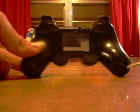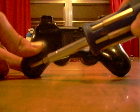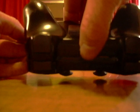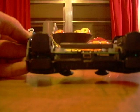If you remove the screw here, here, here, here, and here, it's a total of 5 screws. And then once you remove those, I've already done it for the sake of time, if you'll be careful and tilt this thing forward, then your R2 and L2 buttons won't fall off, and just kind of wiggle that and it'll come right off.